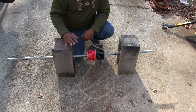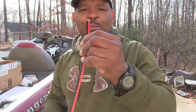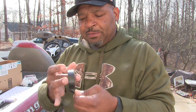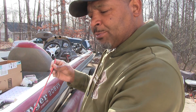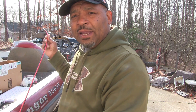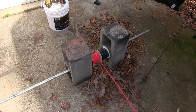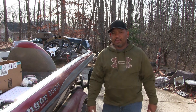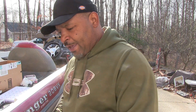Now that we've got this set up, we're going to go ahead and get our length of cable. I've got our two power cables — power and ground — on the spool. What I like to do is just tape them together so I know they're in pairs, because everything takes a power and a ground. I've got the spools at the back of the boat, and I'm just going to walk to the front to get my guesstimated length before I come back and cut them off. I know that's a good length — it's got plenty of extra on it — so I'll get my cutters and cut it off back here in the back.